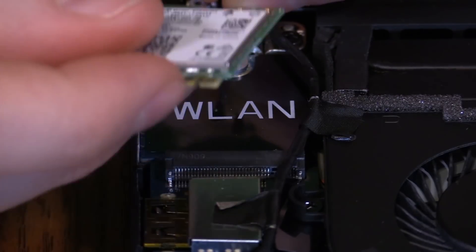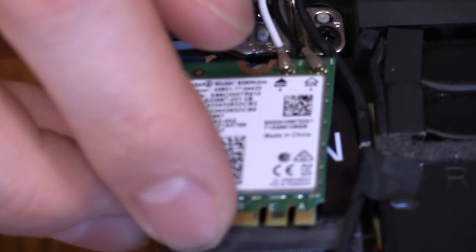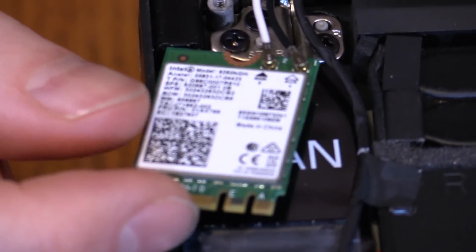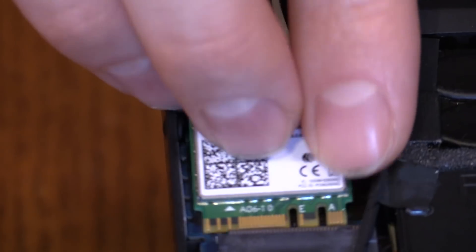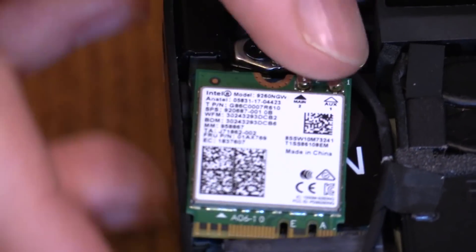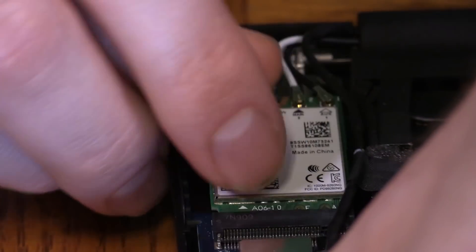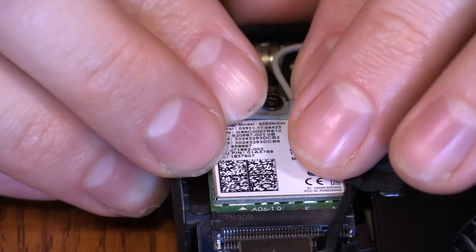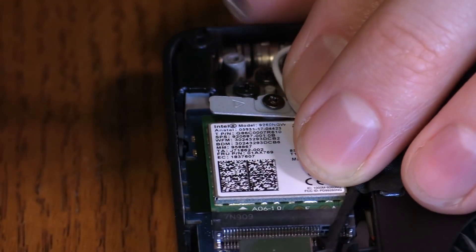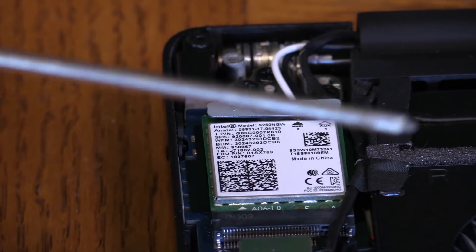Set the old card to the side. I've got the cords and I'm going to plug the new card in the same way. Just to show you a bit closer: we've got the main power connected to main and auxiliary to auxiliary. Take the new card — there's a little pin slot — and insert it into the furthest slot. Line it up and press the card back in and it'll click. Then take the little stopper, set it on top of the card, and screw it back in. Put the back plate back on with all the Torx screws and the Phillips screws and it's reassembled.